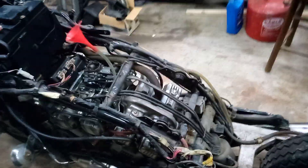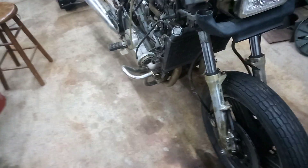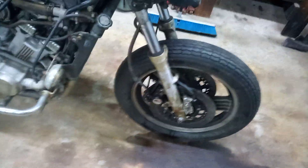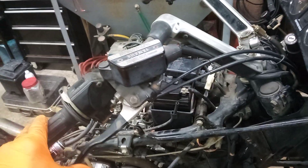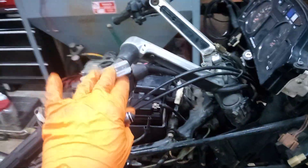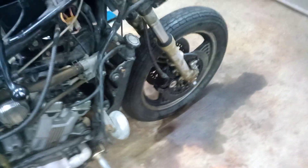I'm going to get this one so I can actually shift it and drive it. I'm going to put some fork oil in these, bleed the brakes, and clean out whatever part of the brake system I have to — if I need to get into the calipers. I like to clean up the pistons and the master cylinder, get in there and clean that up if necessary. First I'll bleed it and see if I can get fresh brake fluid through everywhere without seeing any leaks or major stoppages. I'll just leave it alone for now as long as I've got brakes.